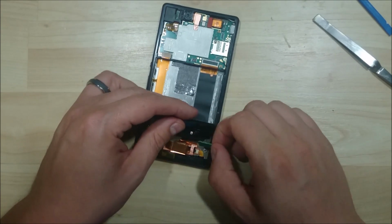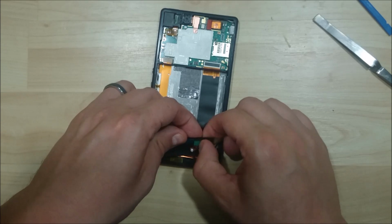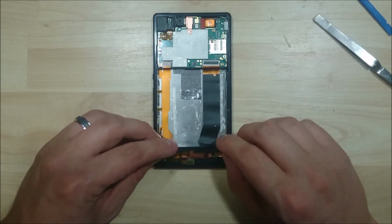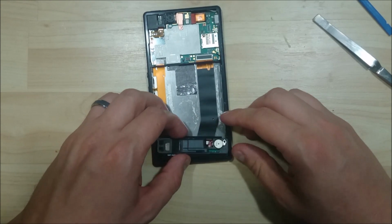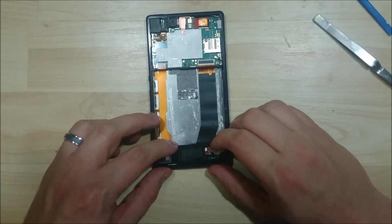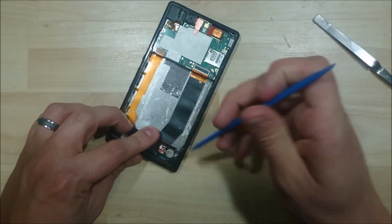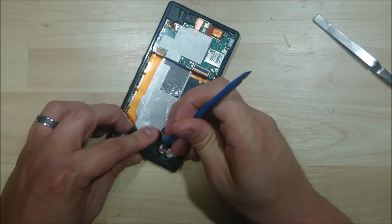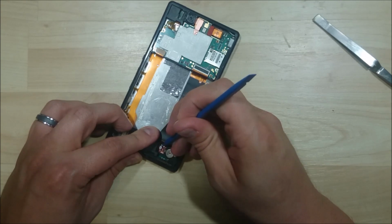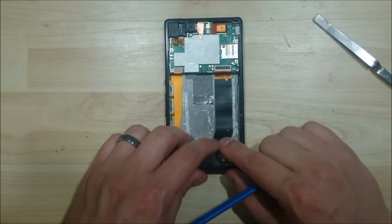Put our bottom assembly in. Just make sure you put this little antenna clip back in its right spot. See, it'll kind of clip into place. Let's go ahead and fold it over. Kind of slides from the top down into the bottom area. We'll have to wiggle around this little speaker connector here to get that to stick on. This can be a little bit tricky.